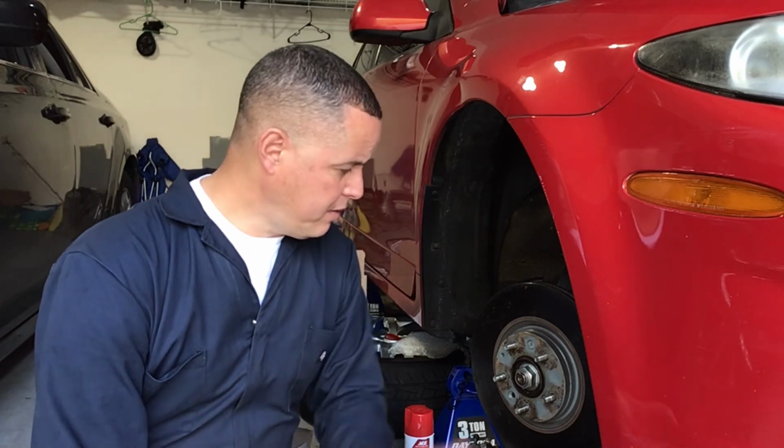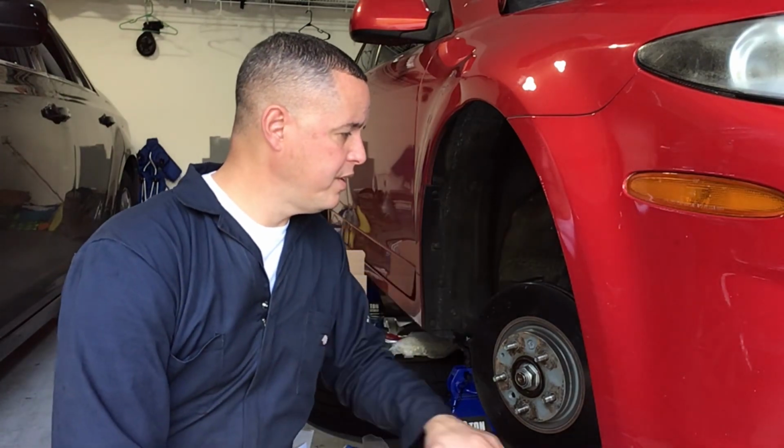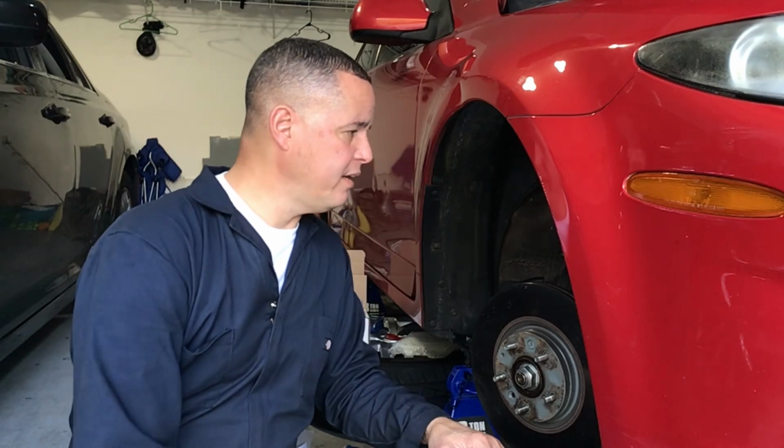We're looking at the wheel right now, or actually the CV shaft, because if you saw the very first video that I posted, we had hit some type of a tarp or a bag or something, and it damaged the CV joint boot. It damaged the brake line. I've replaced that, and rather than replacing just the boots, the inside and the outside, I've decided that I'm just going to go ahead and replace the entire CV shaft. It seems like it'd be a little easier of a job than replacing the boots, so we're going to give it a shot and see how it goes.